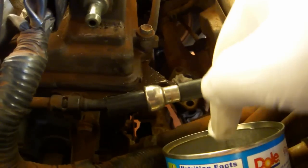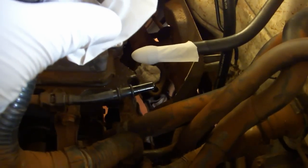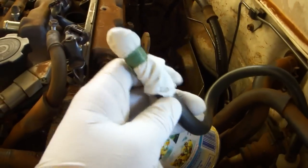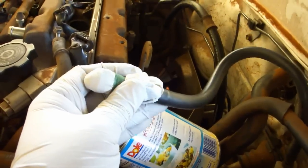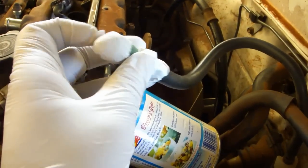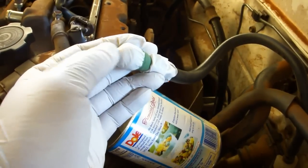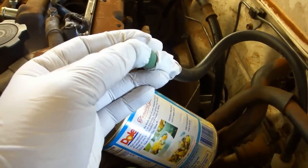Make sure that you get the gasoline in this can. Use the fingertip ends you cut off earlier to cover the hose and the tube. Use some tape to tie up the end. Be absolutely certain you're using nitrile gloves and not latex, because latex will just melt. Also, I used 5 layers of fingertips because these were pretty thin gloves.